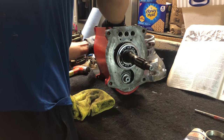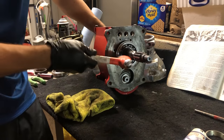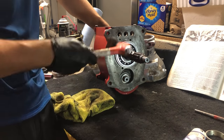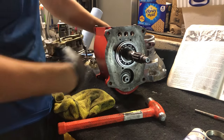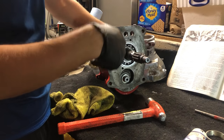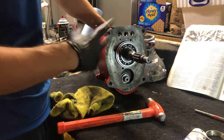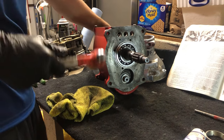The old back end's coming off. They don't say when to cut the wire, actually. I don't like that things keep slipping out the rear. It feels like it's working, but it is going sideways. I'm holding the rear because that final gear — the largest one — is continually threatening to go back out. But now is the time to remove the wire, because this is going in the place of it. Just keep an eye on that rear gear — you don't want it dropping out because the hammering will have it slide off, the dogs will fall out, the ring, the circlip, and then the needle bearings could give you some drama. This is going swimmingly easily into the hole — I don't know if it's because I greased it first or just the clearances.